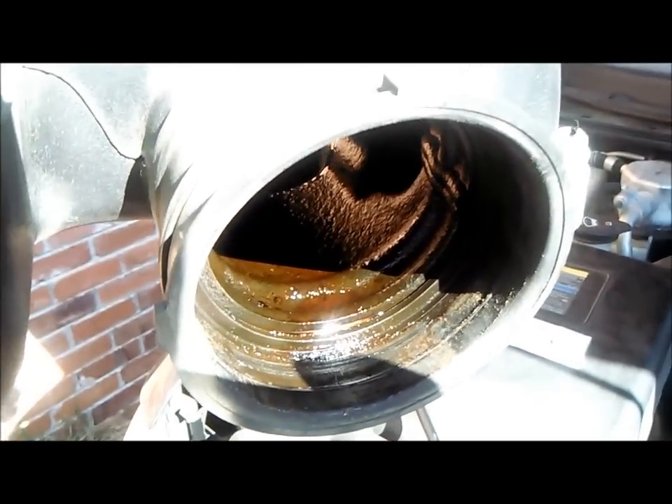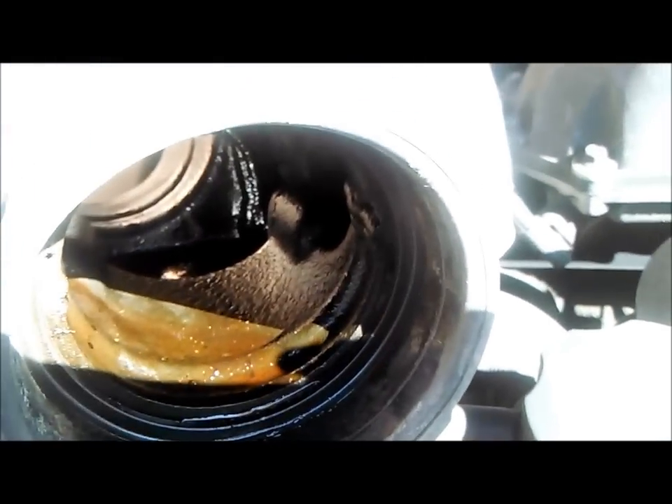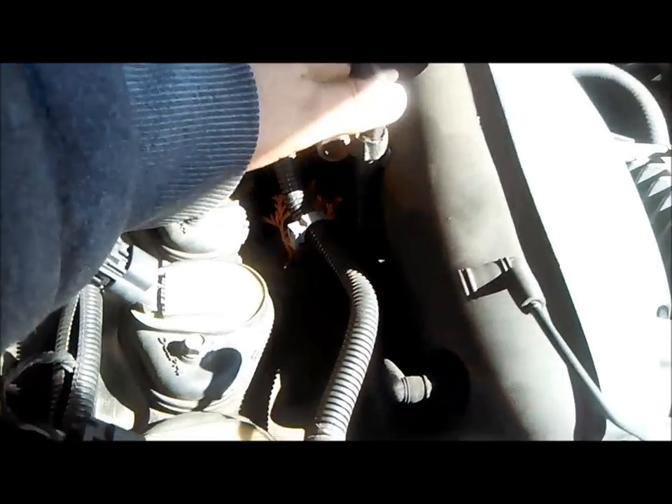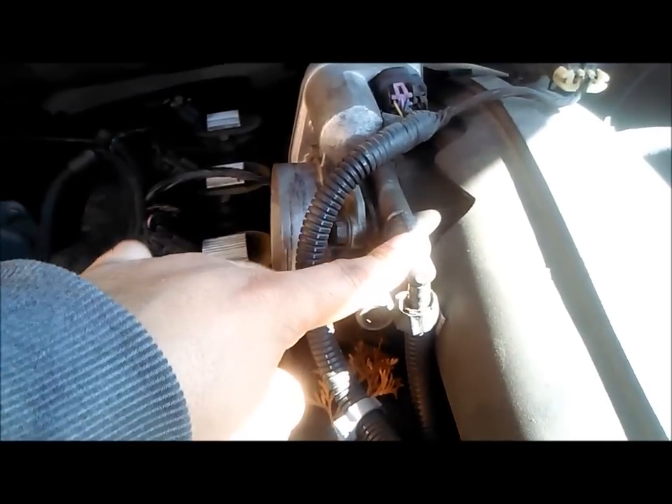See all of that — it's coming from here through this hose up there, and it's like a mess in there. This is just the air from the engine coming back to the intake manifold. So now we're gonna remove this and get it clean.